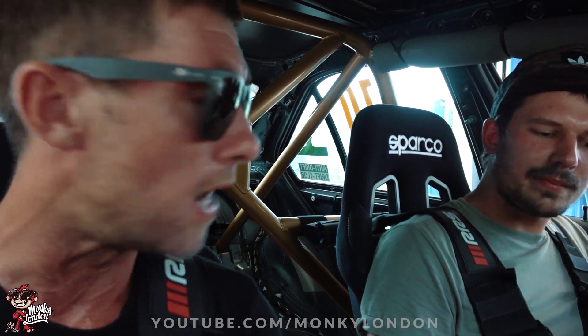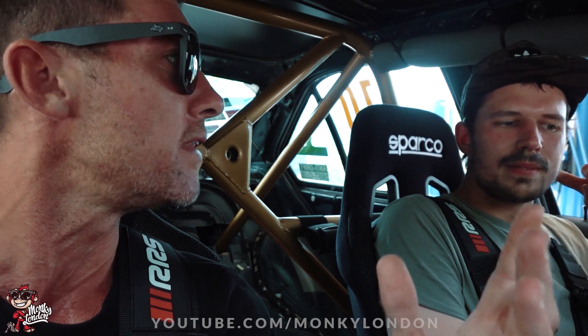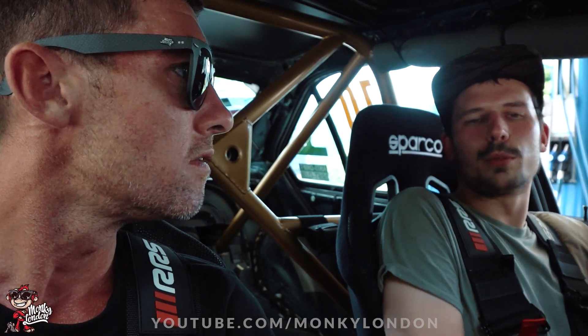We've got some water now so we can stay alive. That's the thing with these cars - when you're running bigger engines, turbos, bigger gearboxes and stripping them out, you do start to feel the heat. With skid cars, the most important thing is keeping not only yourself cool inside, but keeping the engine cool is an absolute fundamental. Whereas regular race cars are on wide open throttle but not hammering off the limiter, a drift car - because you're working the clutch a lot and banging it off the limiter - gets a lot hotter. You don't get so much air through the coolers, which is why a lot of the time you see rear-mounted radiators, because when the guys are sideways they can still pull air into the rad.